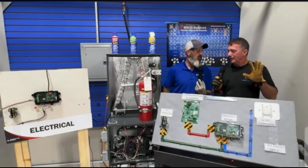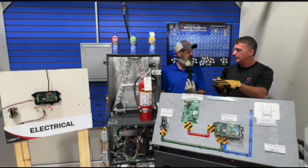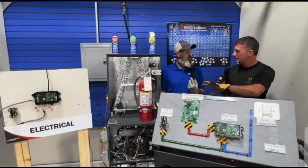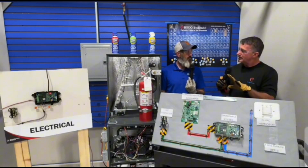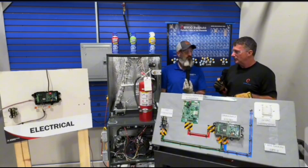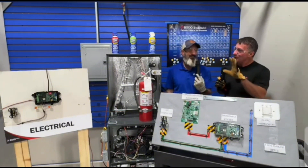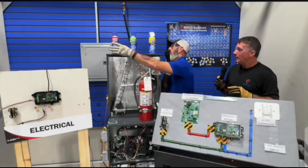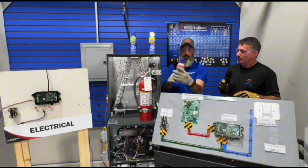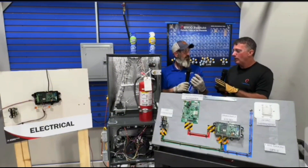Okay Tom, so we went through our five-minute mitigation period. Our blower has reset and we're not detecting refrigerant, so we're basically just in idle mode. We've tested it with R1234YF and our refrigerant detection sensor went into mitigation. How about we try another refrigerant just out of curiosity? The red can is actually R134A.